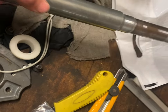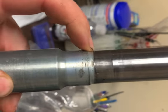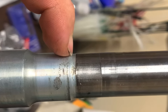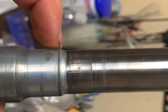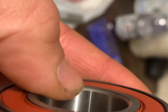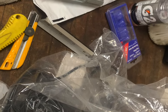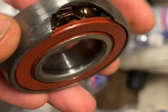After looking at this 4,000 times, I think the shaft will work. The question is whether it's going to be right. You have kind of a divot in there, so that bearing is going to sit right against there. I did think about this — the bearing will push in further than I think because you have this little edge right here. You've got the lip, and if you look at the inside of the bearing, it's kind of smooth, so it would actually push up against it. You can see on the old bearing it's not even completely covering the shaft the way it was sitting.